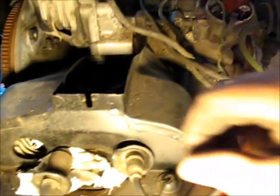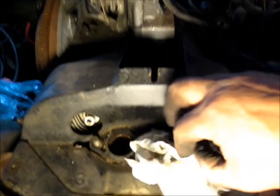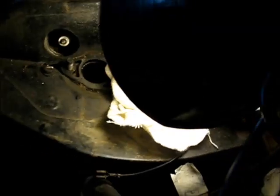My regular intake manifold should fit on here and my distributor seems to be fairly much the same. I want to vacuum out these manifolds — when I took this manifold off, inside of that electronic fuel injection it was nasty. Well, inside of here you can see down in the porthole and that's pretty nasty too. I'll get a vacuum cleaner and vacuum out the portholes before I turn it over again, and we'll do a compression check on it.